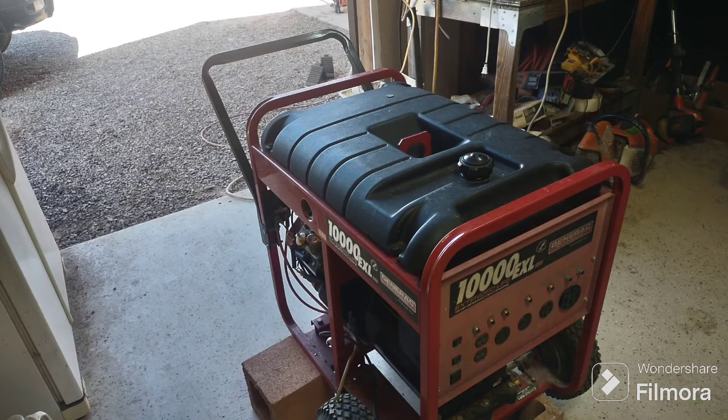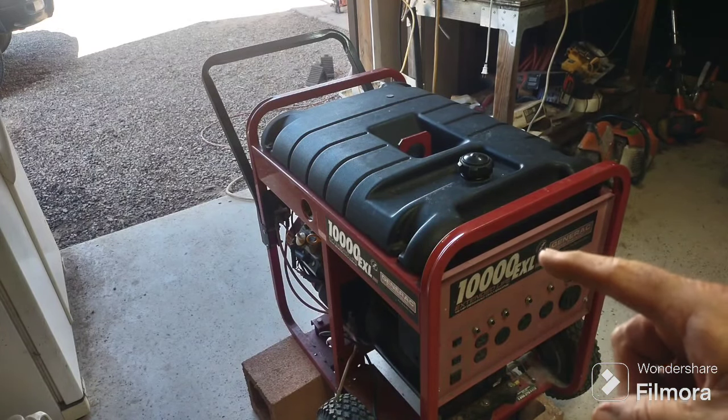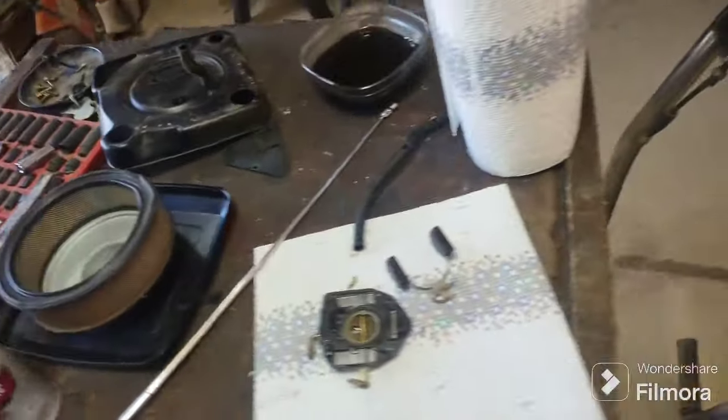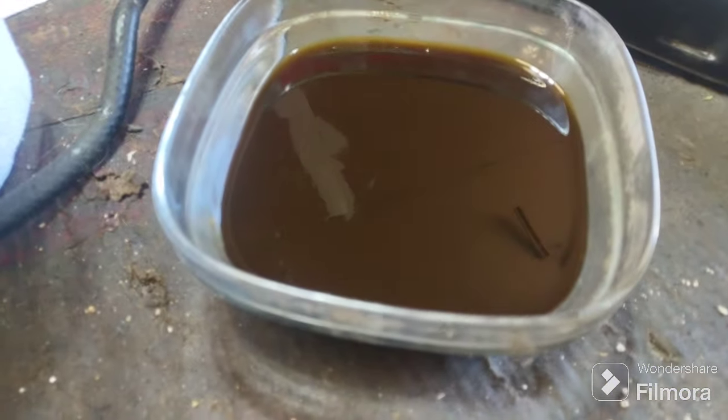It did run, so that's good — we just don't know yet if it makes power. We need to get it running consistently, so I'm going to disconnect the fuel line and make sure it's not all gummed up. It was bought at an auction and doesn't look beat up, so maybe we'll walk into an easy one. I also need to get that excess oil out. I lost a little footage, but here's the oil I removed to bring it down to the proper level — that's how much it was overfilled.